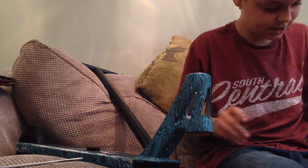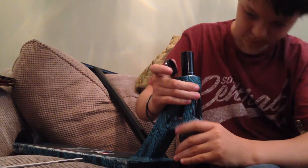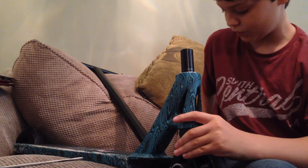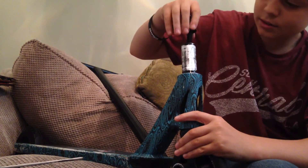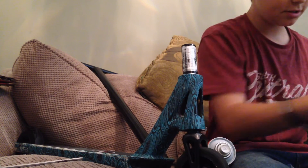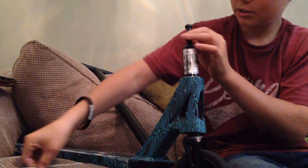The bottom bearings feel fine. Fork again, slide up — sits nicely. Then get this black thing, slide it in, pop it there. Forks are fine. Then get your compression shim, and make sure your bolt is greased because sometimes it seizes up as well. Crown race — don't need that, throw it away. Keep it if you want but you're not going to use it. Pressure bolt greased.